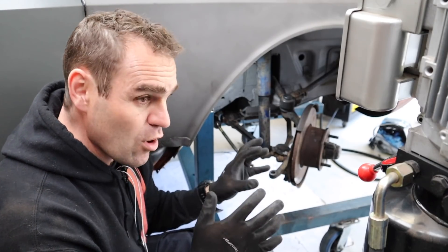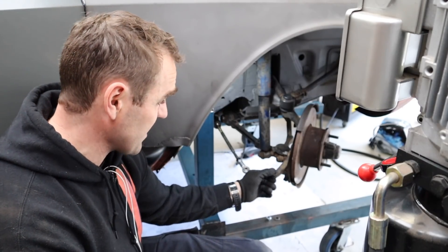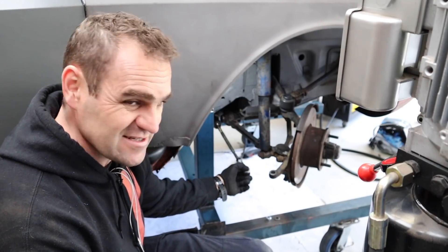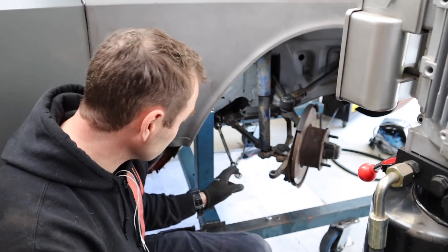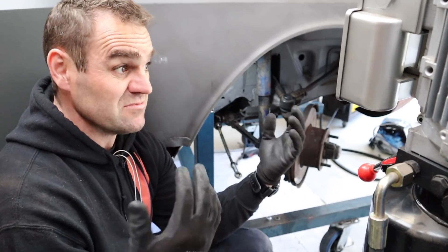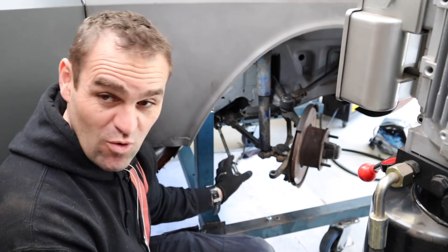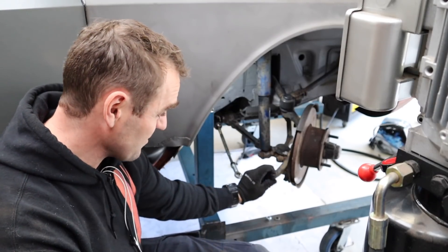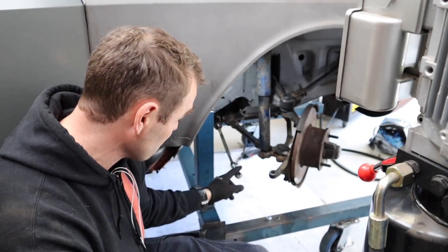I've done a little more research. I was temporarily using rod ends to connect up to the steering arm — that's not ideal. It's okay for a race car but it's open to the elements so you can get dirt and grit in there. I've found that these Toyota tie rods are actually the same thread as Nissan S13 tie rods, and there are lots of drift car parts available including adjustable bump steer tie rods with height adjustments, a wider range of movement, and they're sealed.